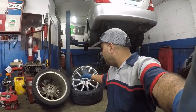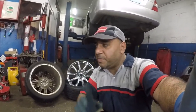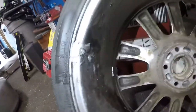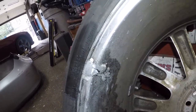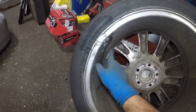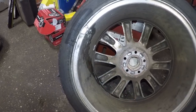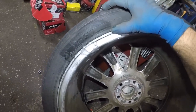I'm gonna be dismounting this tire, but it has a sensor inside so I'm gonna take that off first. What's going on here is the welding — I don't think it was worth it. It leaked a few times from there, leaked again — small little minor leak — but it's just not sitting properly. It's leaking around the rim and not seating properly. Anyway, the customer doesn't want to deal with it anymore.